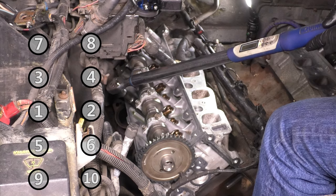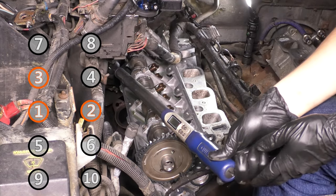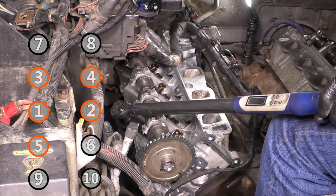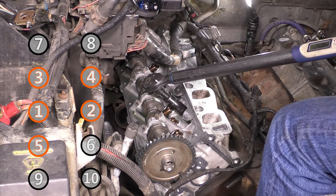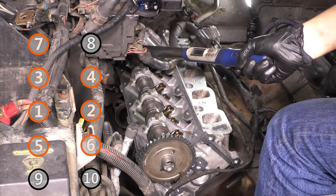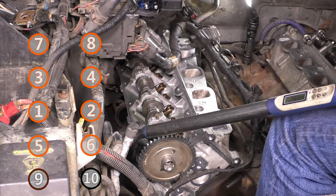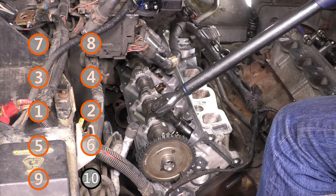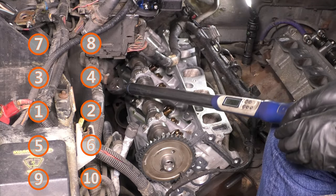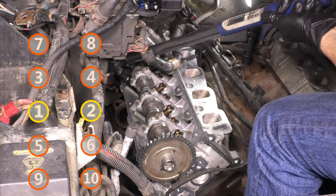Three passes. I again chose to do four and just go ahead and torque it all down to spec. Like I said, first pass, I chose to repeat because of that base torque situation where I wanted to ensure that they were all the same. And it's a good thing I did, because on both heads, the center bolts that I started took another about an eighth of a turn to get back to their initial torque. So even though I torqued them at first, look at how much more movement they are getting on the same torque at a second pass. So just keep that in mind.